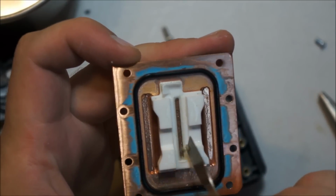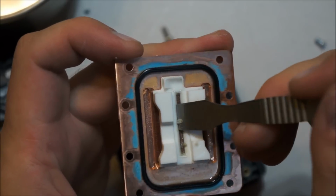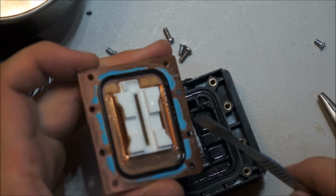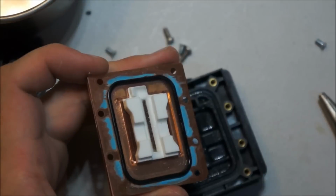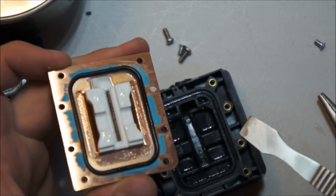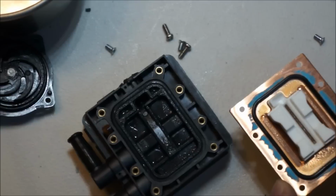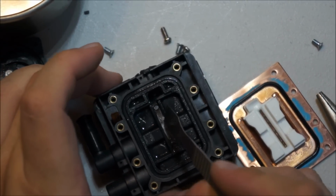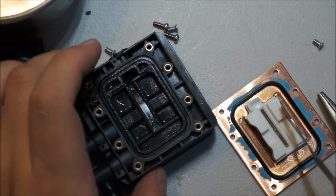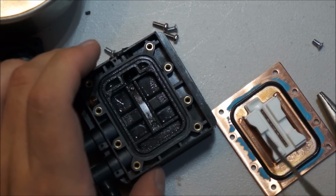It looks like maybe there's some sort of electrochemical corrosion. Normally one of the issues in loops like this is because this is copper and the radiators are normally made of aluminum. You get electrochemical corrosion, and normally they have to put inhibitors and stuff in the coolant, but I wonder if they didn't. So you can see that the fluid enters through this section here, and then effectively it gets forced into the slot in the center and flows out to each side.